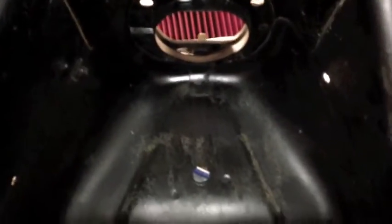I'm going to sand in there one more time, get all that out, blow it out with air, and then show you the undercoated version. Right here there's a small hole — see it right there — and there's one over here. That is drainage, which is very good news; it will allow water to come out and not rest in there. This is all in very good shape. Got to love steel without rust. Undercoating is about to commence — one more air spray to get any dampness out, then we're hitting it with undercoat and starting to put it back together. There is the undercoated version.